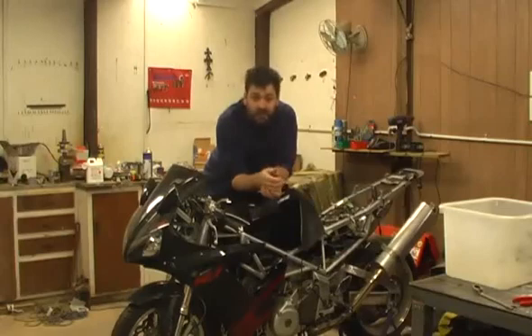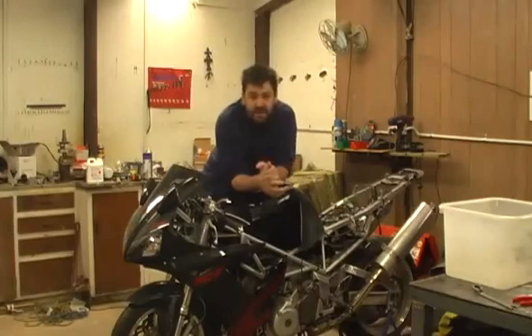You can run micro squirts, people running them on drag cars. There's a dude with a Gladiator tractor puller, and he's running, I think it was 27 litre diesel with 24 spark plugs and injectors on it. That's still running Megasquirt, so you can run it with a single cylinder, two straight, all the way up to pretty much anything you can imagine.